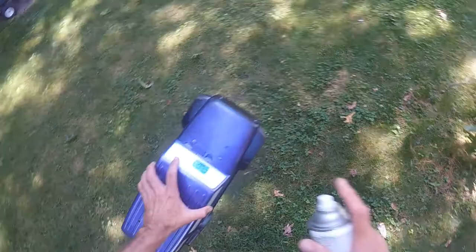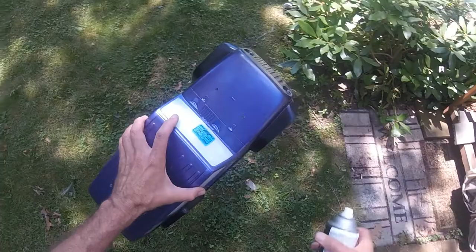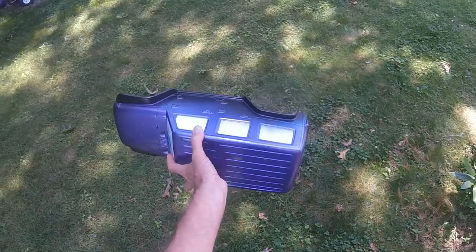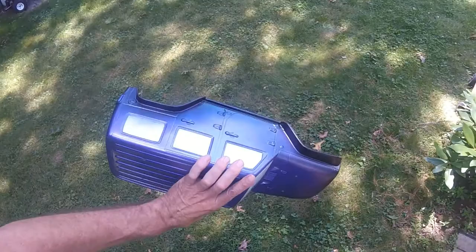We'll put another coat on it, make sure everything's covered, then put some dust coats on holding the can way back so it has a texture — a plasticky texture like you'd see on a fender flare. We'll get back when that's all done, and then we're going to pull the protective film off. I was going to tint the windows but this is going on eBay for sale — I don't need it. I tear bodies up so I don't do them for myself.